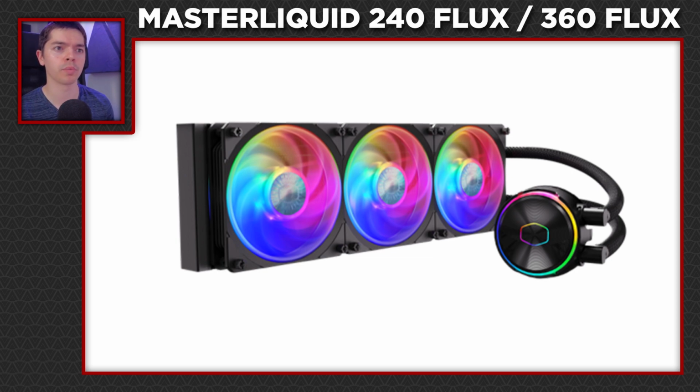You've got all your typical support for say your Intel 1200, 1150 series socket, your AM4, and all the other older sockets for AMD, and TR4, which, for an AIO, it would make sense to use an AIO on a big high power socket like Threadripper. You've got your LED fans, which are addressable Gen 2 RGB ones, which means something, and again, they're 2,300 RPM fans, so they are going to be fast and loud. But you have a 5-year warranty, which I think is pretty good.